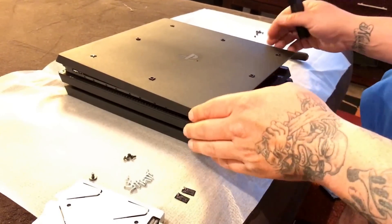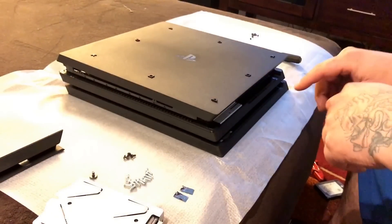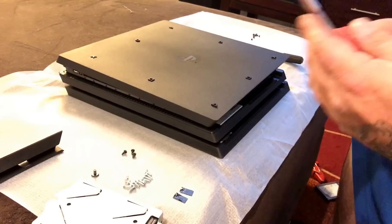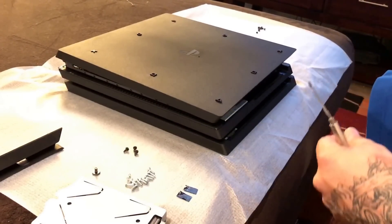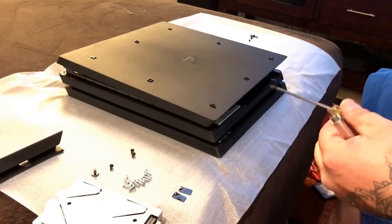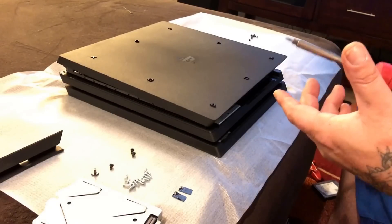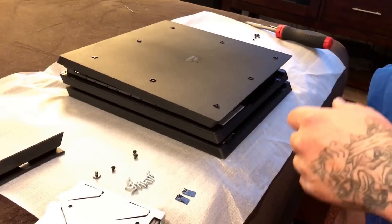Okay guys, I'm back — saved you guys the hassle of watching me take all the screws out. There's a clip right here; put your finger in and pop it out. Then there are three torx head screws and one Phillips head. You need to get yourself a torx head screwdriver. Also get a small Phillips head, and if it's not magnetic, take a small magnet and rub it on there — it picks up your screws. If you have an anti-static wrist strap, use it; they're only about three or four dollars.